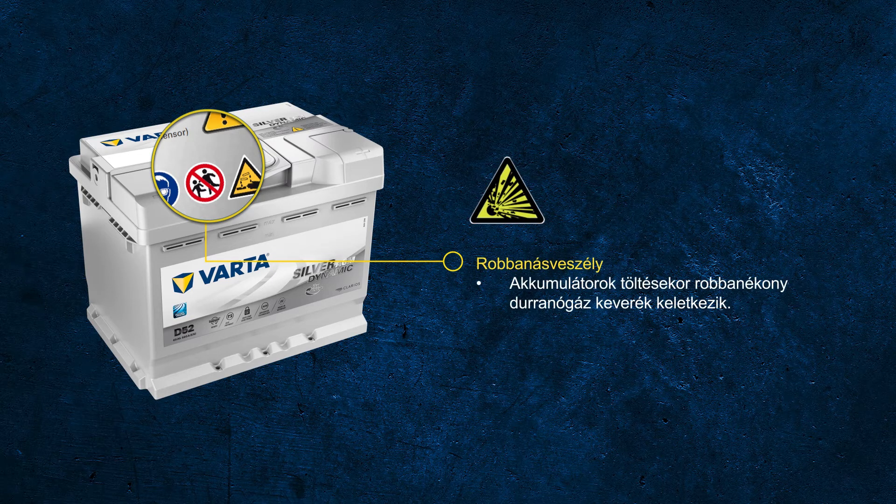When charging a battery, as a side effect some energy is being used for electrolysis, which leads to the production of hydrogen. This is the reason why you must connect the exhaust tube to the battery and close the vent hole on the other side of the battery.